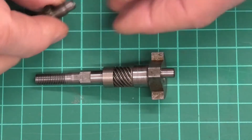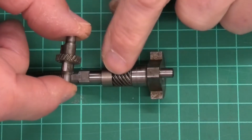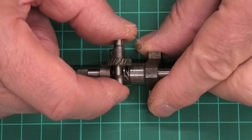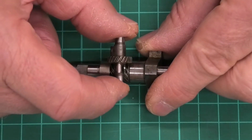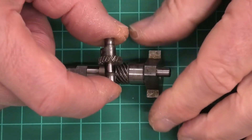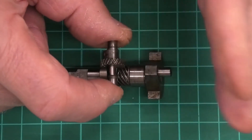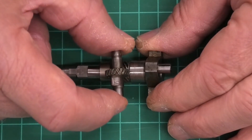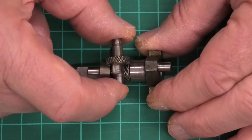The issue we have is caused by the gearing which transfers the direction of rotation 90 degrees from the crankshaft into the camshaft. We've got the spiral gear on the crankshaft and the helical gear on the camshaft. We can't just line the camshaft up exactly where we want it and push it in, because the helical and spiral gears cause a certain degree of rotation as the camshaft goes in, which will put the timing out. So it needs to be positioned slightly to one side of where we want it — slightly forward — to account for that rotation.